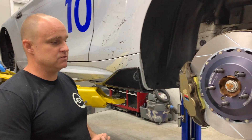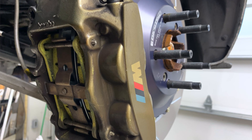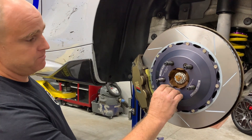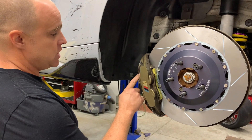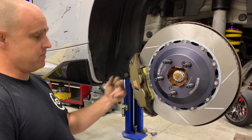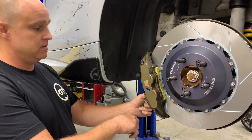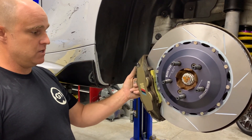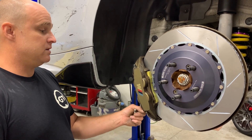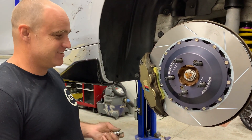The install went really smooth — very simple Brembo design. There's a T55 Torx to remove the caliper and an M6 Allen to remove the rotor itself. Very easy to replace. The pad design uses push pins — simply push the pins out, there's a retaining spring in here, and putting it back together is just the reverse. I like to put one pin in, then install the spring, then install the lower pin, and just tap them into place until you hear them bottom out. When torquing the caliper bolts, not gorilla tight but monkey tight.